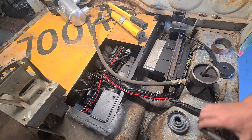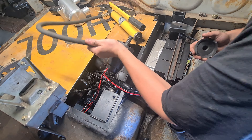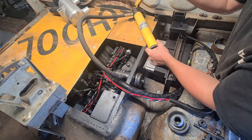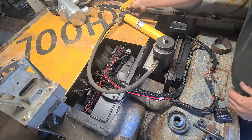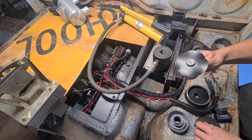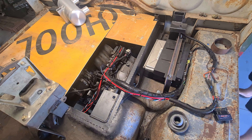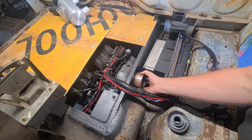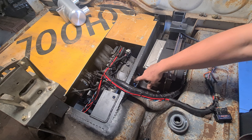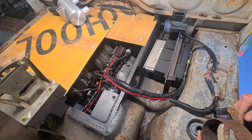It's not the right size for what I need, but it fits this bigger pin so I can go to the next size die. That's the bigger dimple die cut through — there's the piece of steel we just removed. It does bend it a bit, but it makes a really nice clean cut. Now that it's all cut, we'll see if this piece of pipe fits in the hole. That is a very tight fit but it will go — it just needs to be cleaned up a little bit. The tube, not the hole — the hole is actually really nice. I'll clean this up, get it in there, and move all this wiring loom.